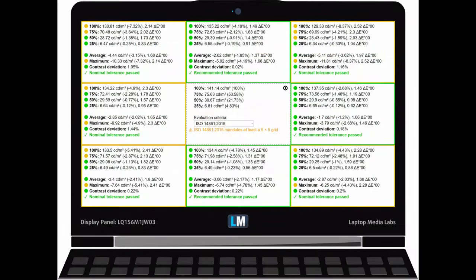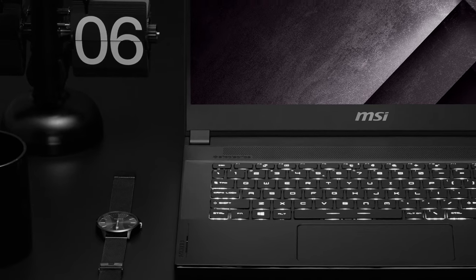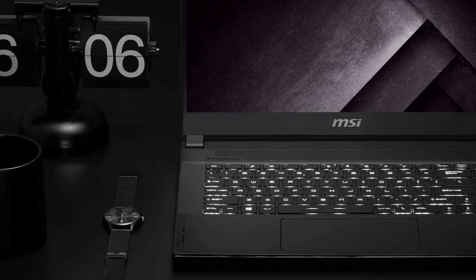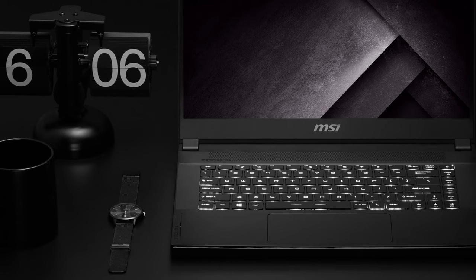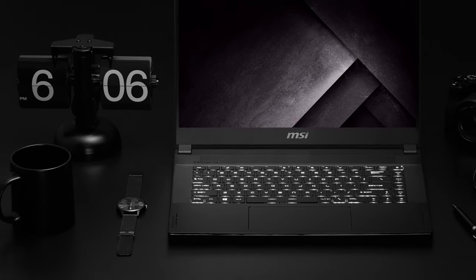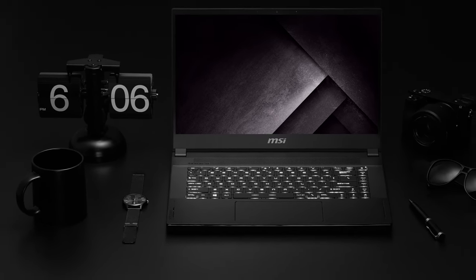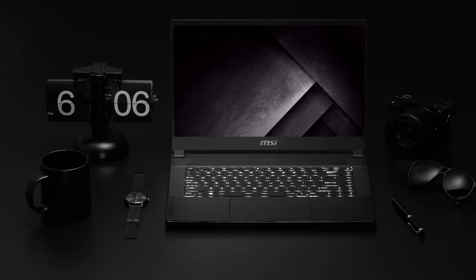In the illustration below, you can see how the display performs from a uniformity perspective. The illustration below shows how matters are for operational brightness levels, approximately 140 nits, in this particular case at 44% brightness, white level equals 141 candelas per square meter, black level equals 0.13. Values of DE2000 over 4.0 should not occur, and this parameter is one of the first you should check if you intend to use the laptop for color sensitive work, a maximum tolerance of 2.0. The contrast ratio is good, 1040 by 1.